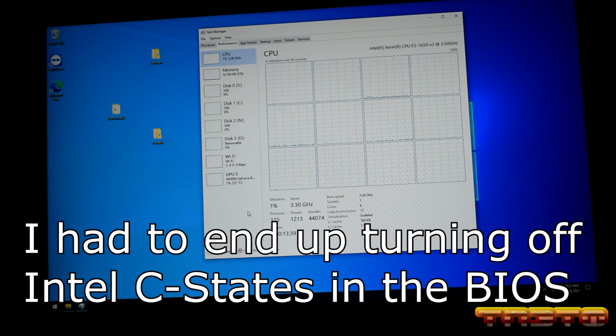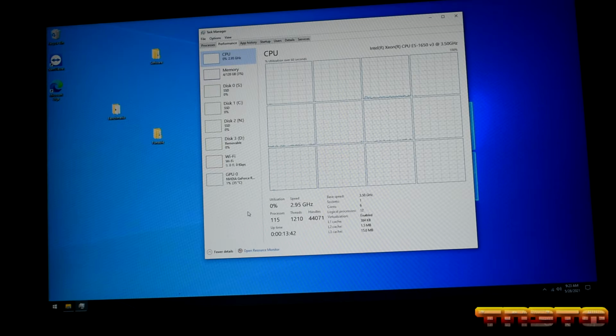something's weird. You may think, oh, maybe it's thermal throttling, maybe it's thermals. Well, here's the thing: the motherboard has an LED on it that tells you the CPU temp, and it is 33 degrees Celsius, jumping from 32 to 33, which is excellent. I mean, mine at idle usually runs around the 40s. But we are downstairs and an air conditioner has been running, so the thermals are excellent. So you would think it would stay clocked. But as you can see, the clock speed's jumping all over the place, even though I have the power options set to maximum. So I have to do some more digging there. Maybe Task Manager is just not reporting it correctly, or I don't know. But yeah, that could be a potential issue I have to look into more.